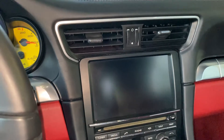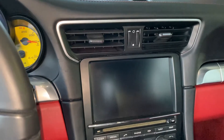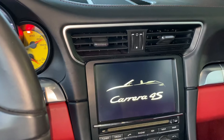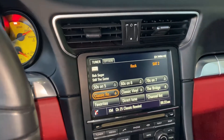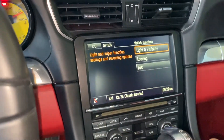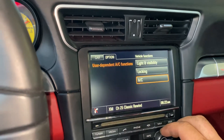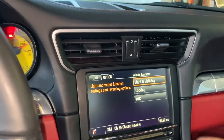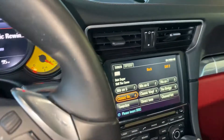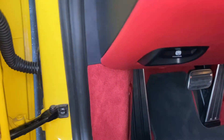I'm going to close the door and reopen it — maybe it's not necessary, but I always do it. I'll put the key back in and the radio is back to working. It doesn't damage anything. If I go to Car Options, Set Car, Vehicle Functions, I do not see the backup camera, so we're going to repeat the process again. I'm glad this happened because it does happen to some customers and they get worried.